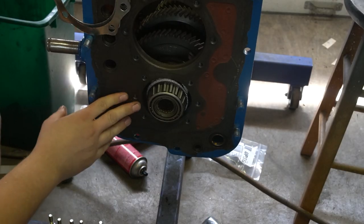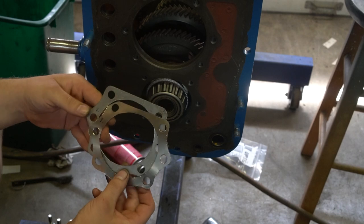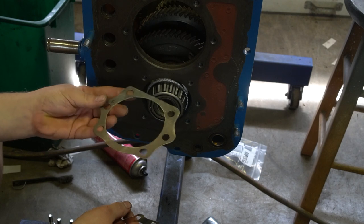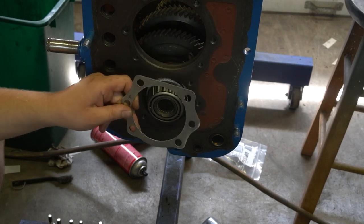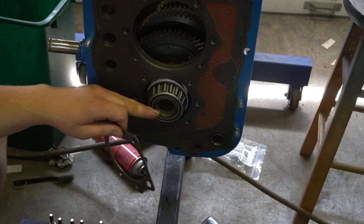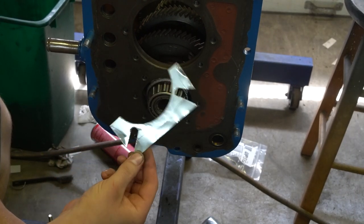I didn't really have much luck finding shims for this, so I made them all. I have two of them because I kind of messed up on the measuring. When I initially did this I thought I only needed 35 thousandths, which is what this one was. I put it in there and went back to look at my spring scale and I was actually looking at kilograms instead of pounds. So with just a 35-thousandth shim I had a pull of about 22 pounds. Since I have all new bearings, my manual calls for 14 to 17, and old bearings was 6 to 8. So I got creative and made two little half-shims out of some zinc from a zinc plating kit - actually a roof flashing. These measure ten-thousandths.